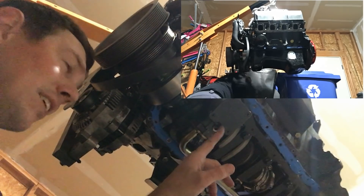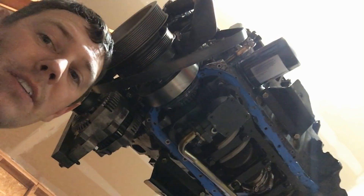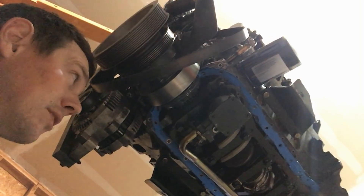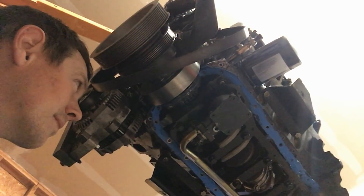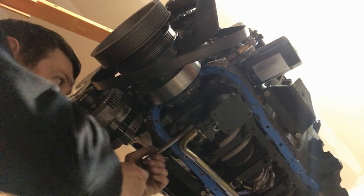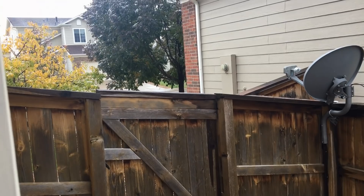I did just a tiny bit of silicone around this because if it gets inside and interferes with the oil pump itself, we would be shoving chunks of stuff into the oiling system, which is not what I want to do. The pickup tube — I'm glad it was something easy.